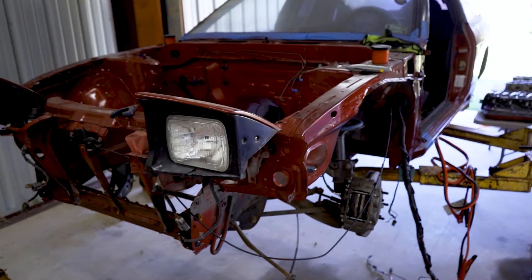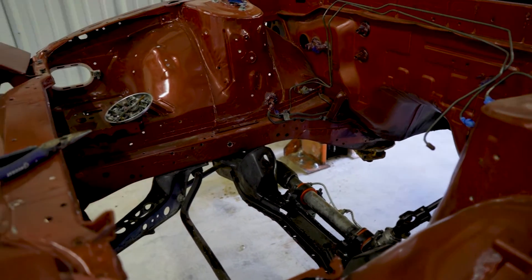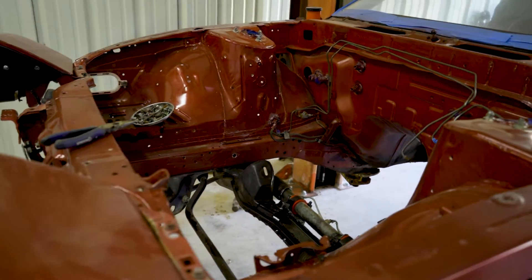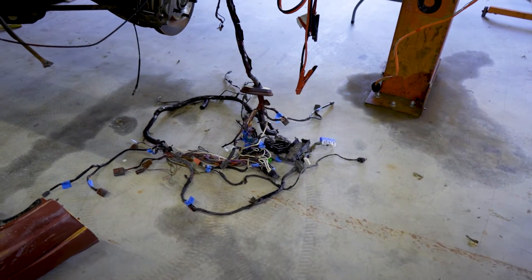More importantly, what we're doing today — we're working on the 240. Last time I showed y'all this car, I was finishing up the painting of the engine bay. I've cleared it, pulled away all the masking stuff. It looks okay, definitely better than it did a year ago, but still not ideal. Anyway, the painting is done and some reassembly is happening. I'm working on that pile of spaghetti and I'd like to do a light harness tuck. We're not going to use very much of the original engine bay harness, so I'm going to strip out almost everything besides headlight wires from the body harness.